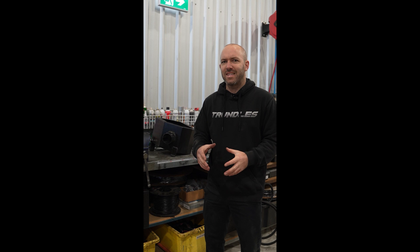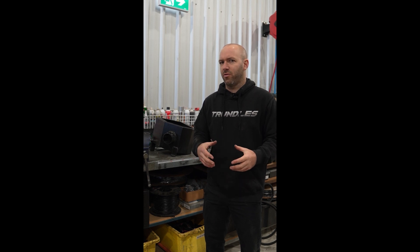I've got a K-Series N80 Hilux here that came in for a dyno and a couple of other mods. The results were not great straight off the bat and I knew there was a bit of an issue, so I popped the airflow meter out only to find there were no air straighteners. I thought I'd show guys that are into engineering or doing a bit of four-wheel drive fabrication some of the things you've got to consider.